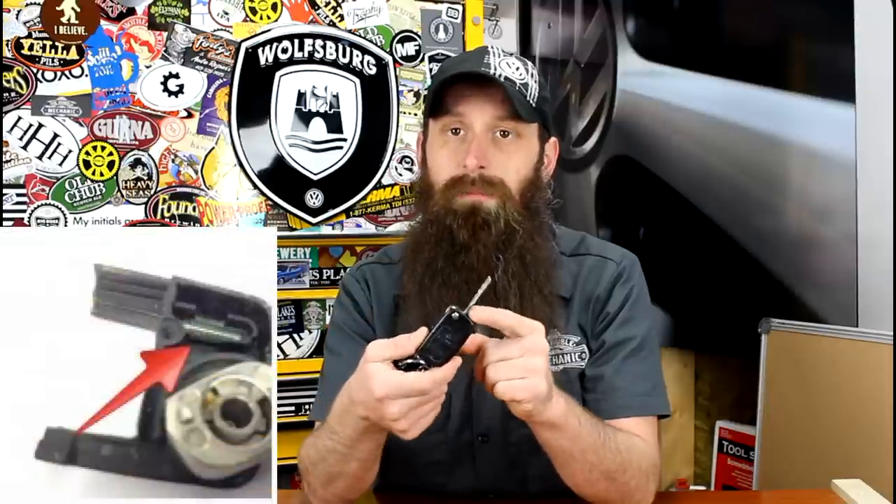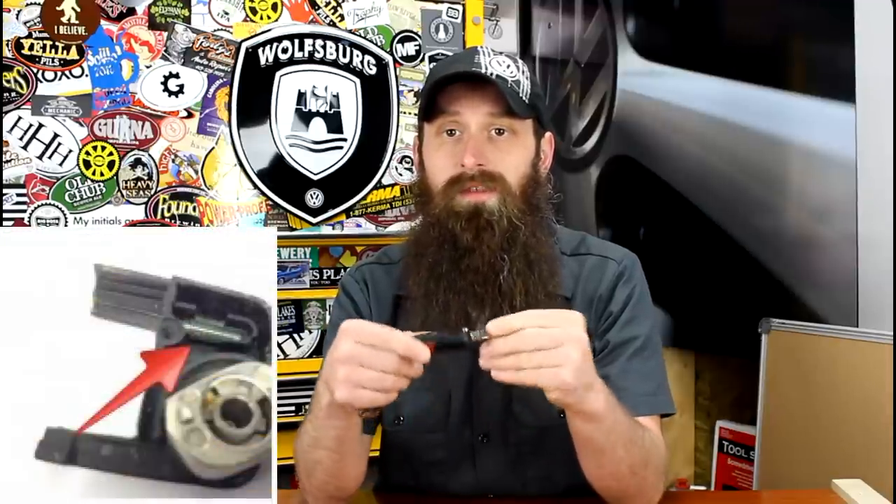But it's more than just a mechanical part. There's also a little pill inside the key portion that functions with the immobilizer system of the vehicle. The immobilizer system is what prevents you from basically hot-wiring the car and stealing it. It also provides signal for lock and unlock. So it is one of the theft deterrent systems built into your Volkswagen and pretty much every other car — my Nissan key has that same chip inside it as well. Signals are transmitted to and from the key to make these functions happen, and the vehicle does computations to make sure the key is in fact the right key, giving the car a start or no-start signal.